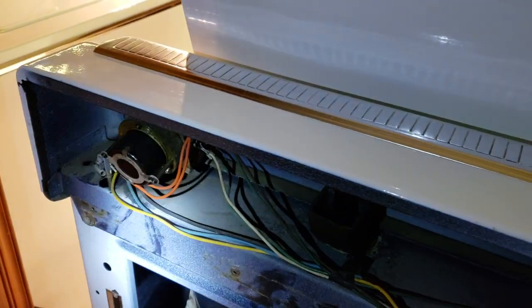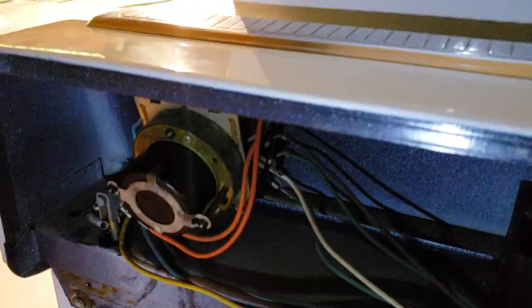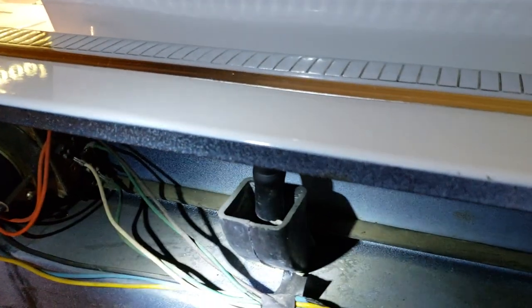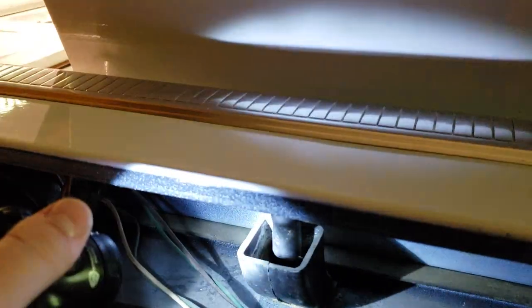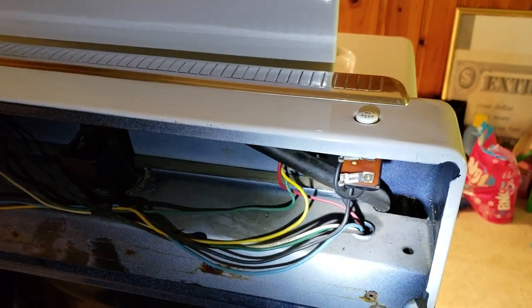Let me get a light. The back panel is somewhere around here — I just have it off, so I'm keeping an eye on it while I'm running it, since it is an old machine. There's the timer. There's the fill valve — this is not original, it came off another machine. It was back-flowing because of the water pressure. I think the lady who had it before had low water pressure.